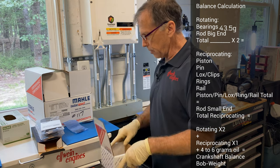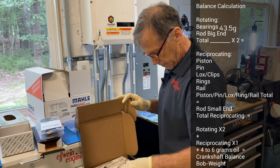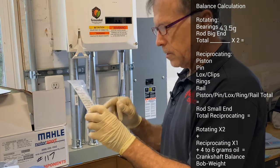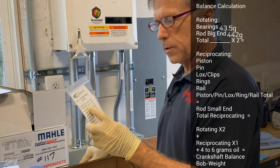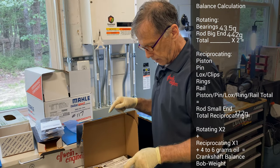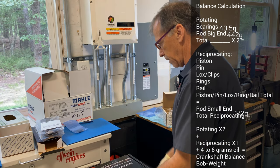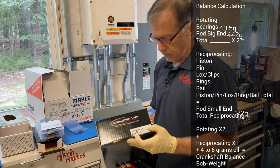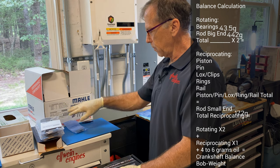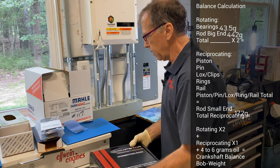For the rod, I don't weigh the rod myself — I take the weights from the manufacturer data and write those down, just making sure you don't transpose wrong. 442 grams for the rotating weight, the big end. 172 grams for the small end. This will be within two grams. Make sure you don't mix these rods up with any other set. I wrote on here they're for project number 117. These pistons are for a 3.875 stroke. This is a 3.875 stroke crank — I'm just verifying, validating.